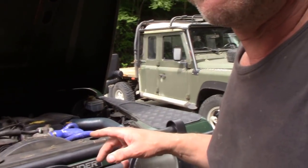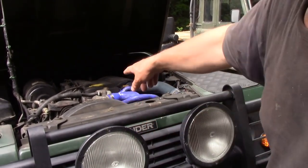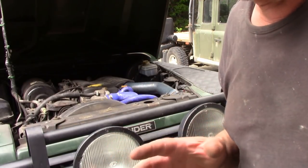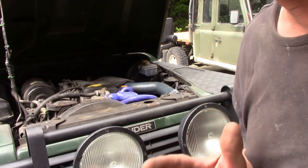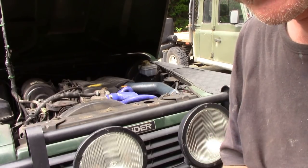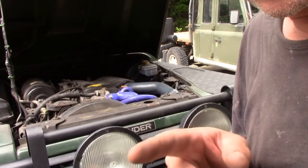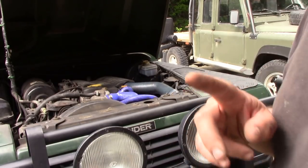It's really a mystery so I've got to take this head off and put it under pressure — like 130 psi — to see if there are any cracks. I have a suspicion it might be cracked in either the exhaust port or in one of the glow plug tube holes. It's losing water somewhere but I can't find out where.